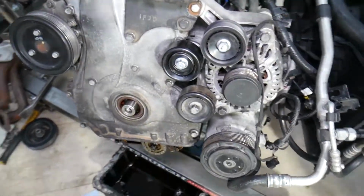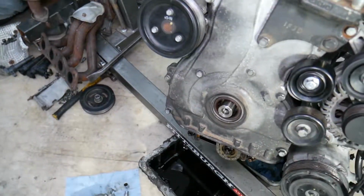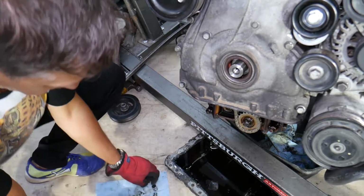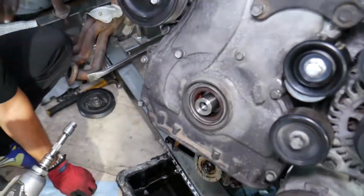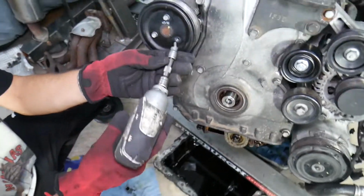So once we remove the oil pan, okay, right here, we remove the valve cover already. Oil pan's been removed. You don't need to remove the intake manifold for the valve cover, but we made our videos, guys, how to do it. And if you're using the special tools for the crankshaft pulley, you will need to remove the intake manifold. If you want to see the video, it's on our channel.